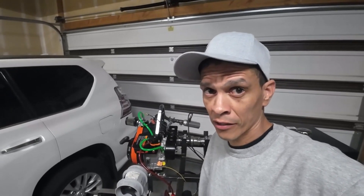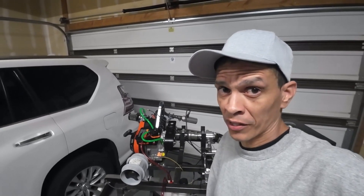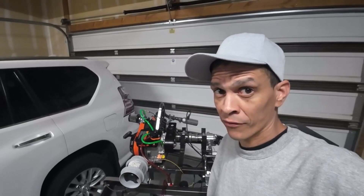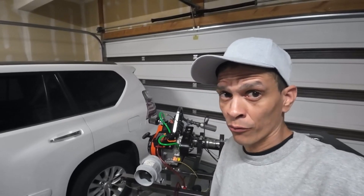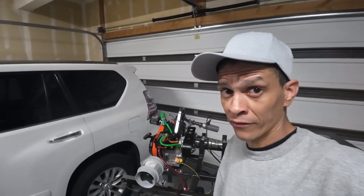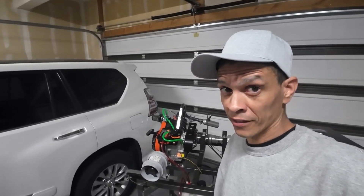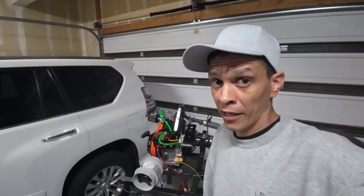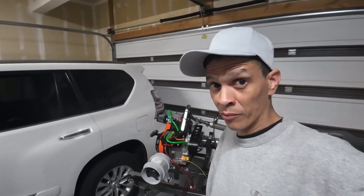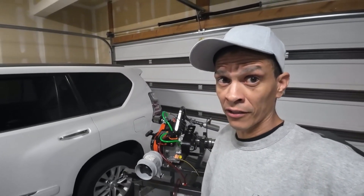In this one we're going to go ahead and test all 5 clip positions on the needle and carburetor. But before we get into that, there's been a couple of changes — a quick update. I did an oil change on the engine after the initial dyno pull and the break-in. I've also ran the carburetor through the ultrasonic cleaner — it was sputtering at about 4500 RPM, so I've gone ahead and cleaned that up just for good measure. I also realigned the intake manifold to the carburetor out of the box — it was lined up terribly, so I've gone ahead and realigned that.